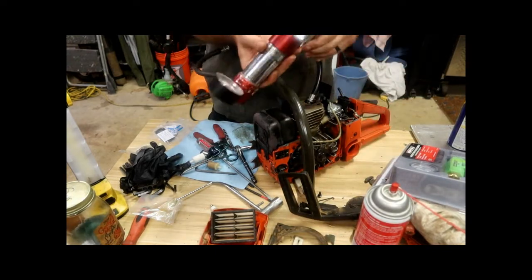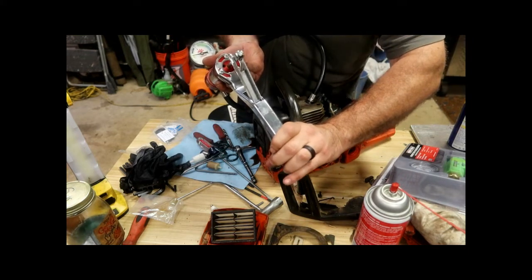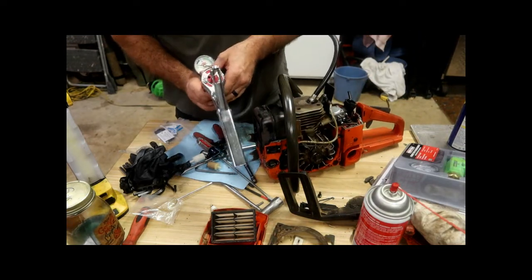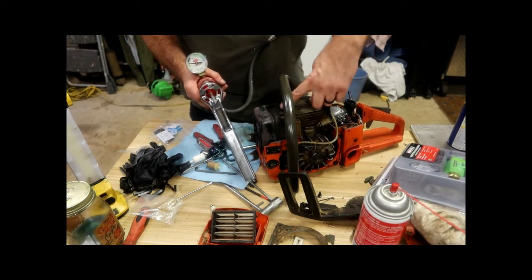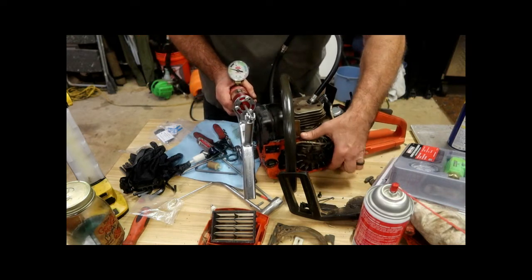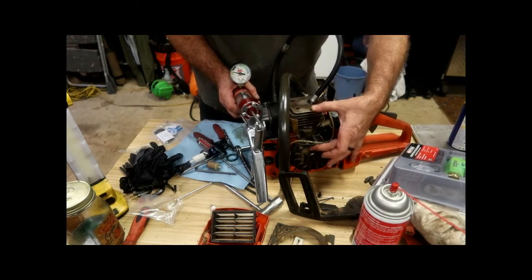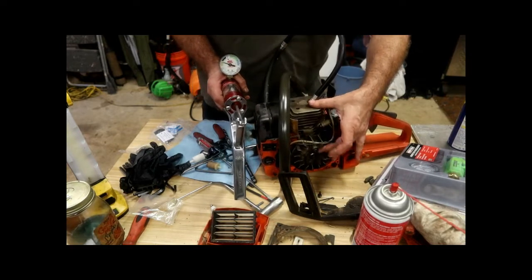I'm going to try to pump it up to six pounds of pressure, and I really don't want to go past six pounds. They tell you that if you've got everything perfect, it'll hold for 24 hours and all that. But I've got some connection issues here and rubber seals, so realistically, if you've got it holding like that, there's no massive leak occurring. Also, when you turn the saw, watch what happens to the needle — it will adjust as you're turning the saw. I kind of wish I had a little more compression on this thing, because generally when you're turning it, that needle usually bounces quite a bit more. So it's very possible we need to put a ring in this thing, but it's not scored.